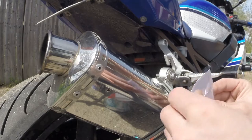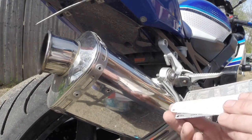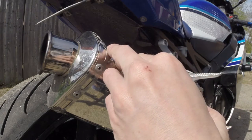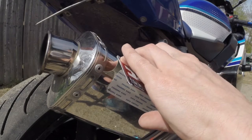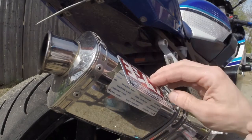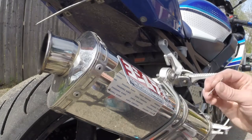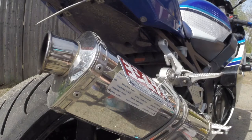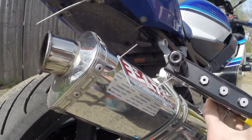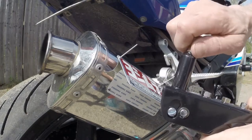We have our new badge — it came with a little sticker and a wonderful thank you note. Thank you, eleven dollars on eBay. I peel the adhesive backing down halfway to start with, get the holes lined up on the top, kind of get it into place, and use that adhesive backing to keep it there. Then we can go ahead and get our rivets — use the smallest rivet size in the kit, put the small end in, line it up, and get both rivets in place.